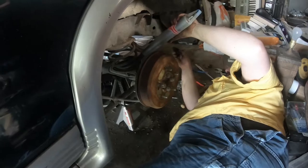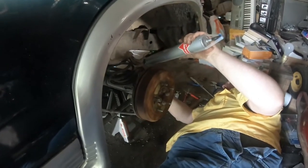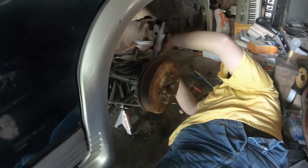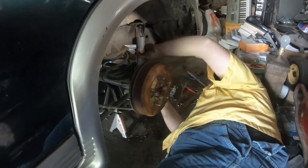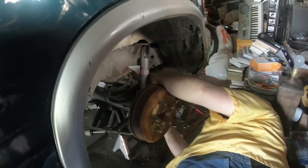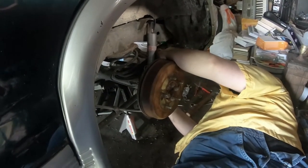Even the spring is technically easy because you just have to brace up at the frames and drop the axle down, and then get a spring compressor. And I don't do spring compressors. Yeah, you don't want to be standing in front of wherever that spring may land. You do the compressor — it should not go flying anywhere. But if it lets go, I had a relative who died from that.